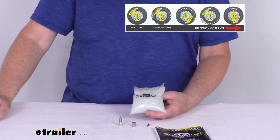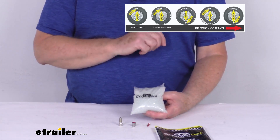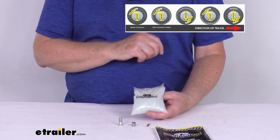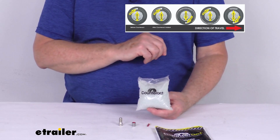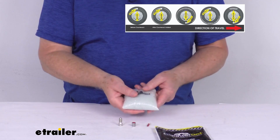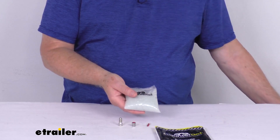the heavy spot in your unbalanced tire will pull up and down on your vehicle suspension. This causes the beads to shift in the opposite direction of that pull. The beads will continue to migrate until there's enough of them on the opposite side of the heavy spot to balance out your tire. These tire balancing beads continuously and automatically readjust the balance of your single trailer tire. They reduce vibration, ensure even wear to increase tire life, and even help improve fuel economy.